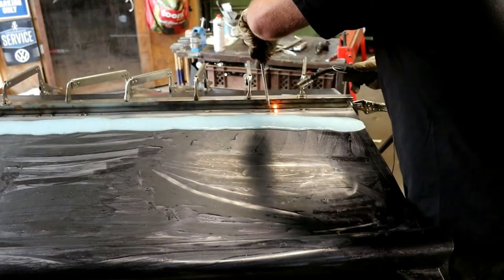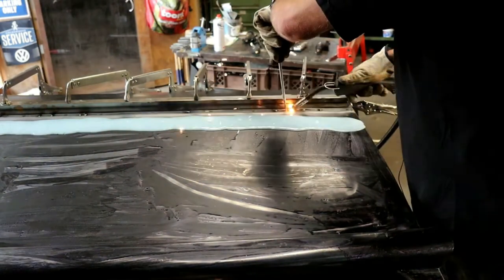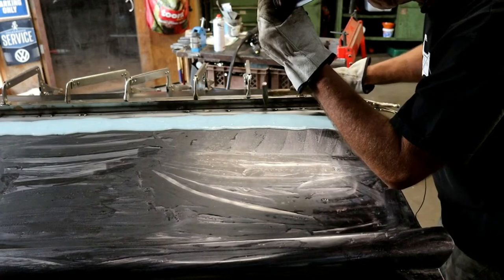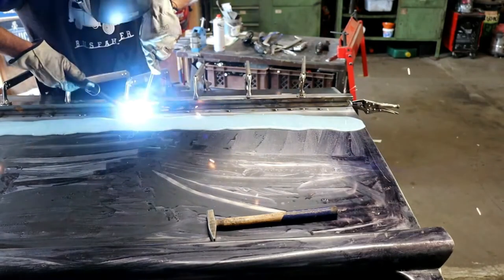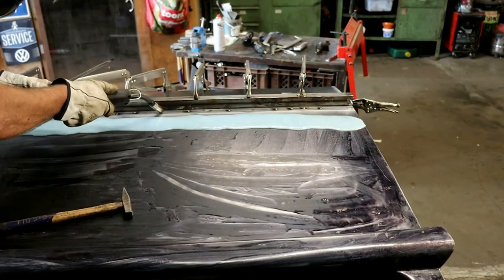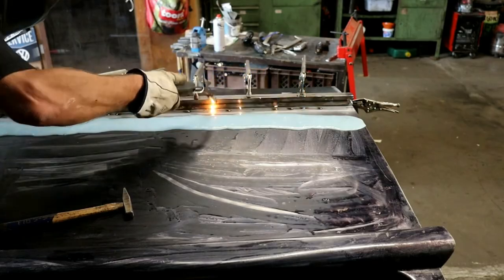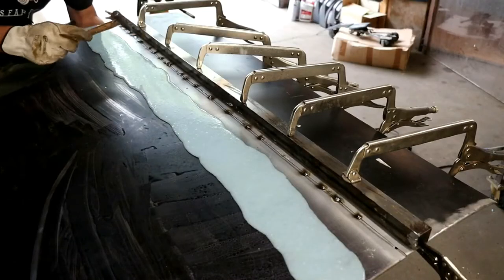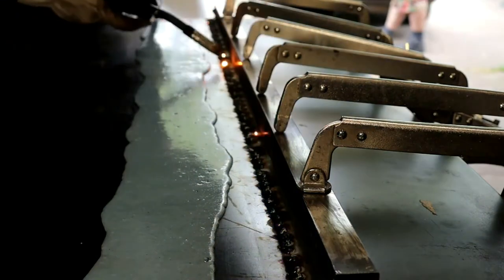In the foreground you can see the blue mass. This is a kind of heat blocker, but it is of little use and also attacks the sheet metal. All that remains is the classic welding technique of cooling with compressed air after each welding point and setting the next point at a distant point. This is time consuming but prevents the sheets from warping.